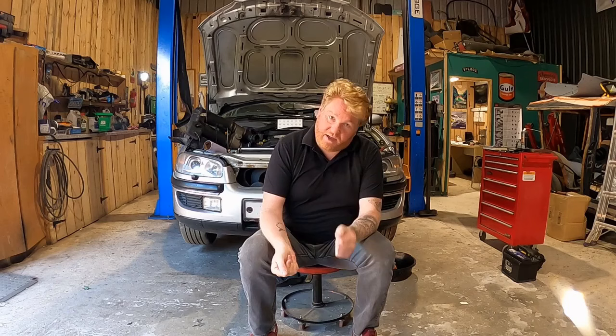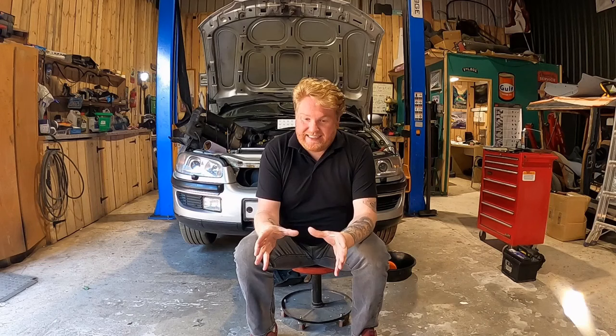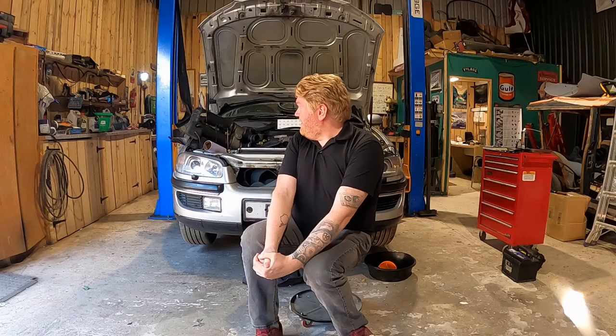So the car's ECU takes that data from the brakes ECU, and the reason it does that from the ABS ECU is because of the ABS rings. Now the ABS rings are fantastic for telling the car's ECU exactly how fast you're going. It's not going to work off the mile per hour gauge in the gearbox, even if it has that. I don't even think it has that. It might do. Yeah, I think it is mechanical. I don't really know anything. But yeah, that's all that has to happen.